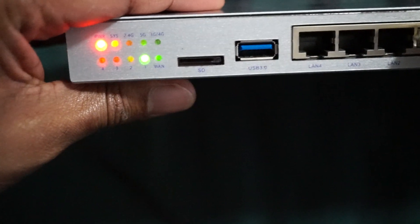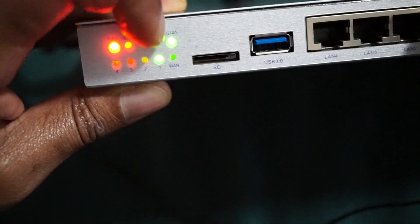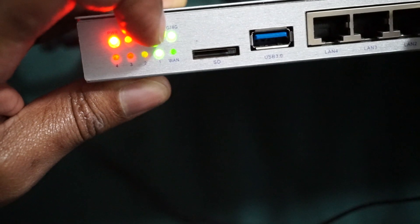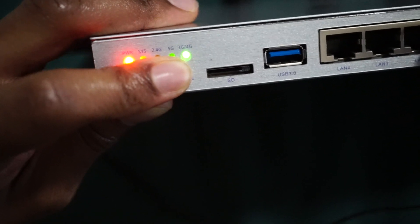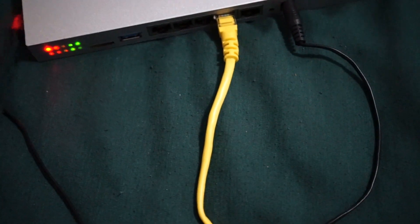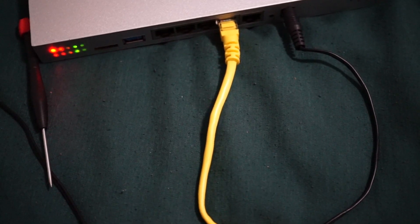Hold the button while the lights start to flash. What you want to wait for is that specific light to come on. Wait for it to start flashing — you see how this light is flashing repeatedly? That's what you want. Ignore the light down here; what you're looking for is the one with my finger next to it, flashing repeatedly and very slowly. Once you see that, you can release the button and set the screwdriver aside. Now we're going to go over to the computer and I'll show you what IP address to type in, and after that I'll show you how to flash.